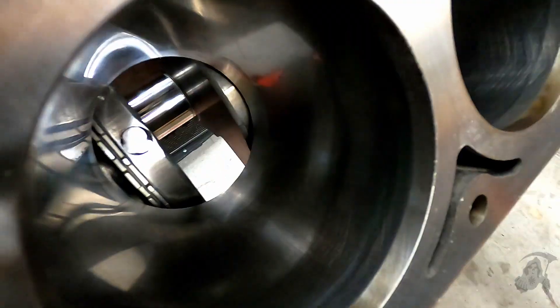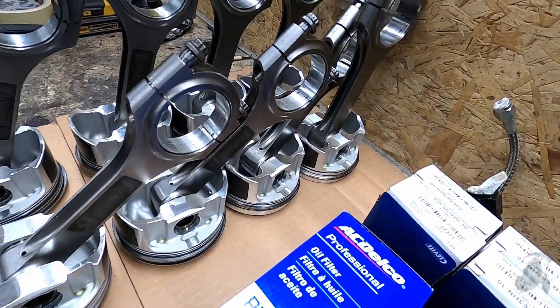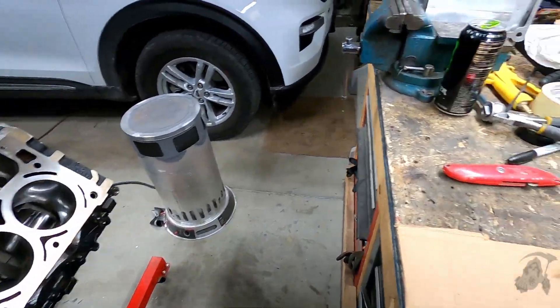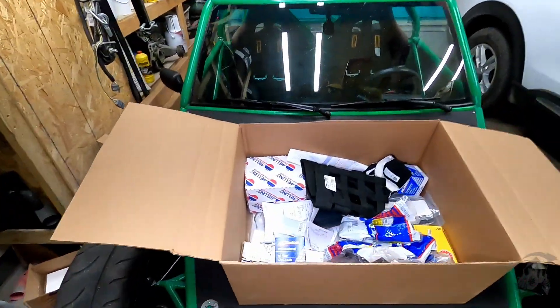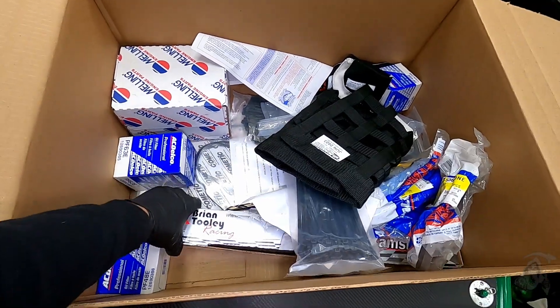Left the bores alone. As you can tell, they're still showing all the crosshatches. We're using all the piston rings — they're all still nice and sharp. Got to put new rod bearings in. They put new cam bearings in here also, so it got wiped out. Other than that, everything's cleaned up and ready to go. Brand new lifters. And then I got this lovely box of parts here — got a new gasket kit, new oil pump, new camshaft — same camshaft spec.